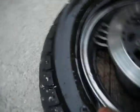I remember one time years ago, I told a friend of mine, we always had tire changing contests with our dirt bikes. These were tube tires. I don't know if you guys are dirt riders or not, but with bead locks, my KX500 had 2 or 3 bead locks in it. They're a pain. It's a T-shaped thing that goes inside of the wheel and pulls down on the bead to keep it in spot. So if you get a flat tire, the tire will stay right on. You just keep right on riding, racing. You can win races like that.